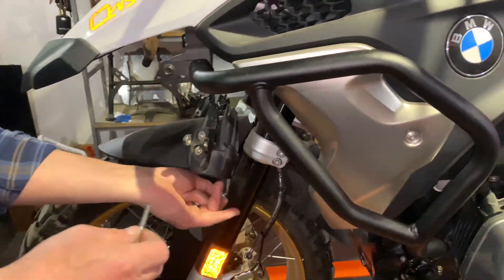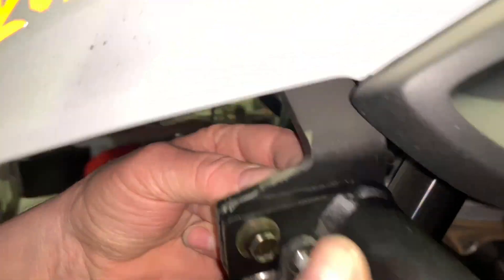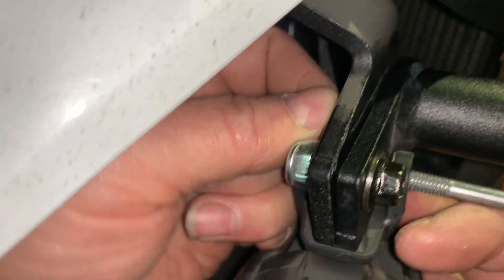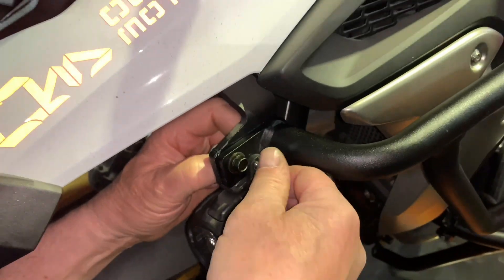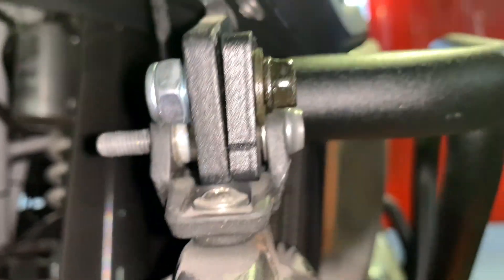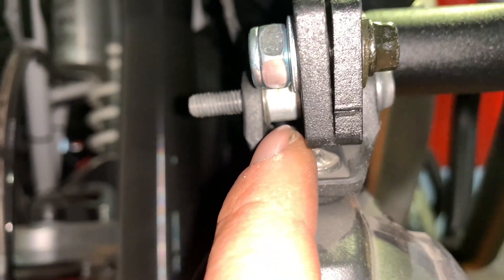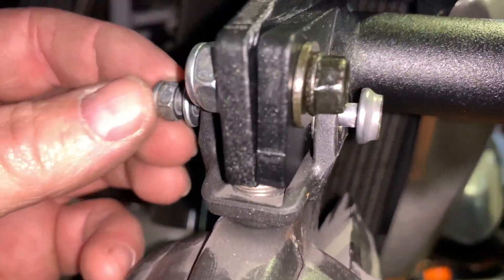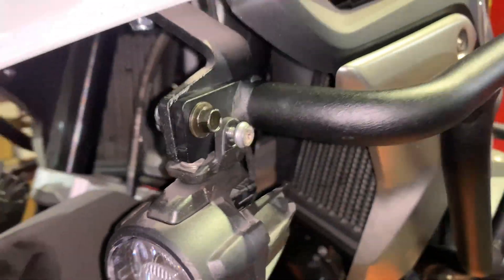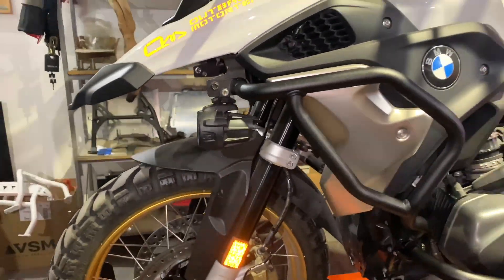Here's the additional OEM driving light mounting. Push the bolt halfway through, then put the little spacer in between on the back side. Push the bolt through to about halfway, put in the spacer, let the bolt come through, and then spin on the OEM nut. After that, you need to adjust the height of your lights the way you like it or the way it's supposed to be.